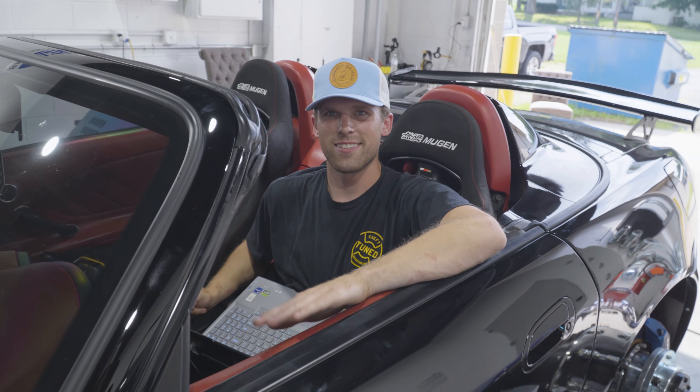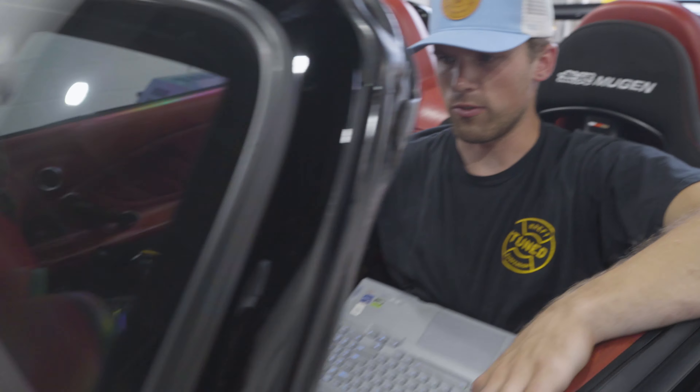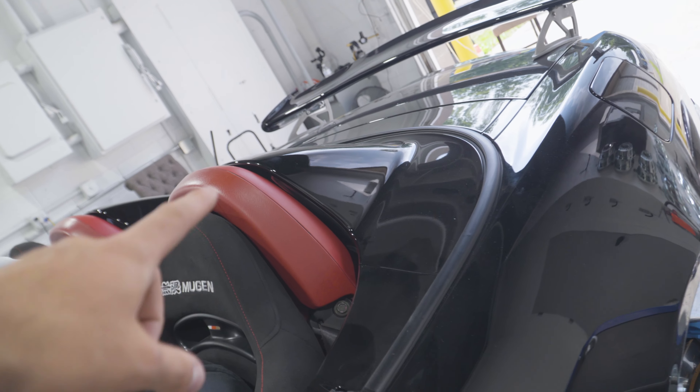The injectors should let us go further — might have to crank up the base pressure, but should push us into the 600s. Pretty sweet little car: 500 horsepower in a 2,300-pound car, this thing's going to rip. It looks beautiful and clean — it's got all the good parts. We'll see it again when it's ready for flex fuel.